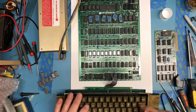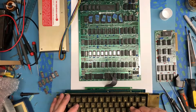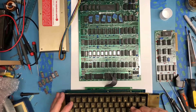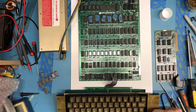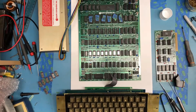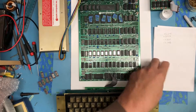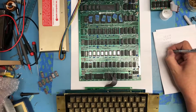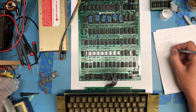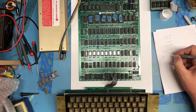I'm going to do a PRINT FRE, parenthesis — I saw something about how to detect the amount of RAM installed using PRINT FRE(0). So with 16K in, doing a PRINT FRE(0) returns 14333.